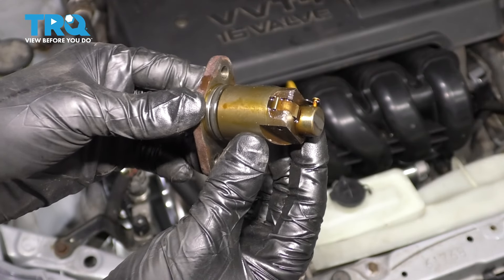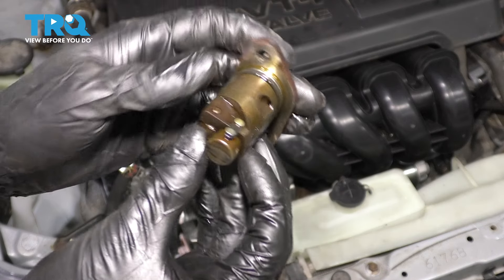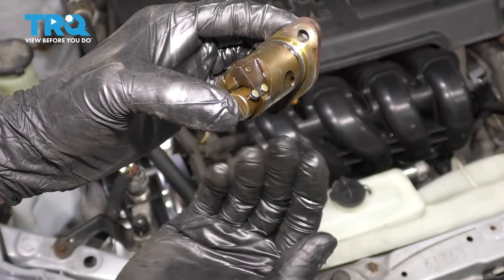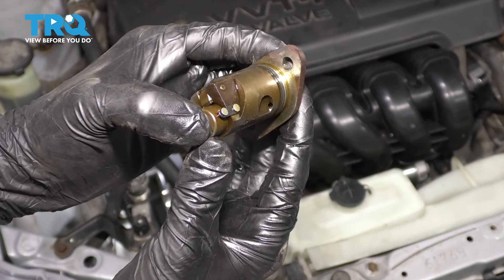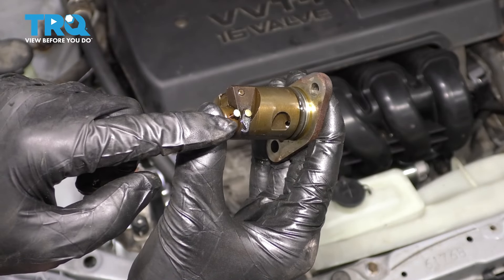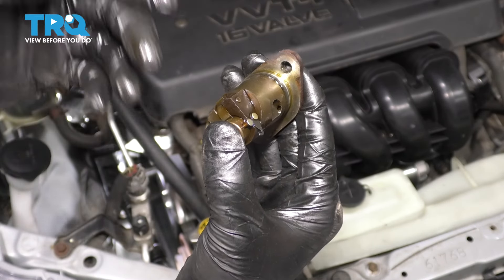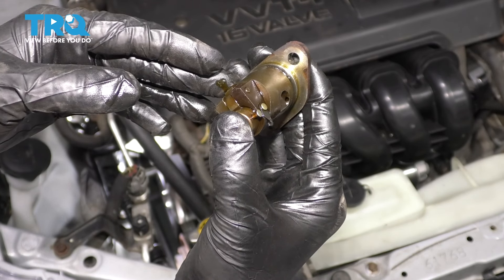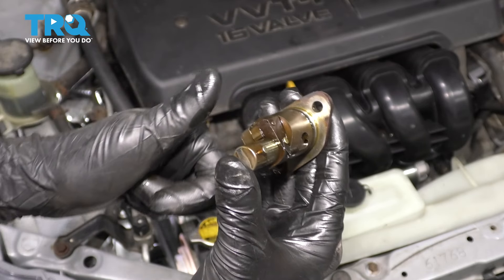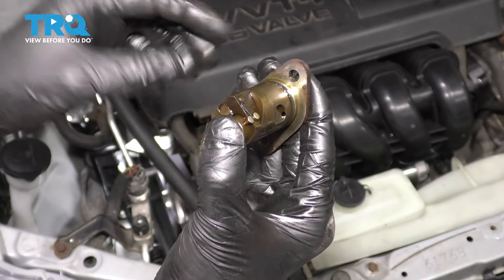Now I'm going to run you through the procedure of applying tension to this tensioner. I'll show you on the old one so you can imagine what's happening on the new one inside the engine. When you have this bolted up in the engine, this hook opens up downward. What we want to do is rotate the engine counterclockwise just a little bit — that will apply tension to the timing chain on the tensioner side, pushing it in and releasing this hook as gravity pulls it down. Then once you go counterclockwise about a half a turn, don't go more than that, then turn clockwise — that will release tension off the timing chain on that side, and the tensioner will expand to its proper distance.